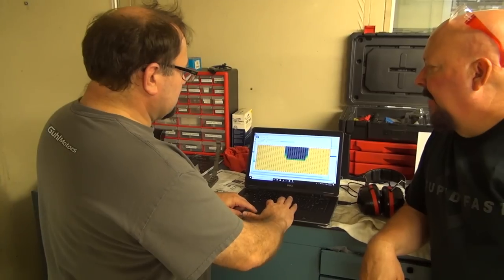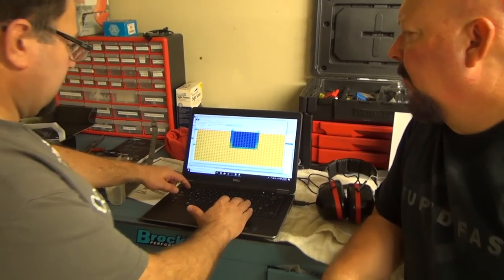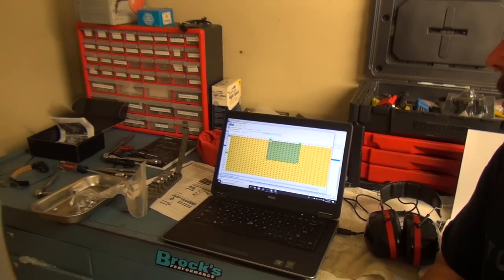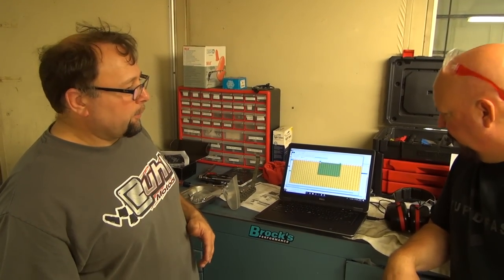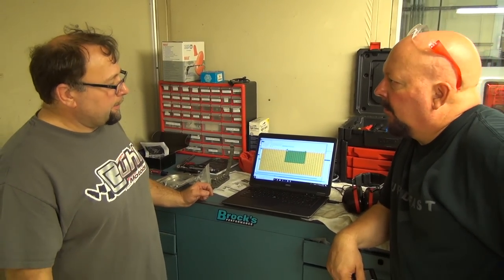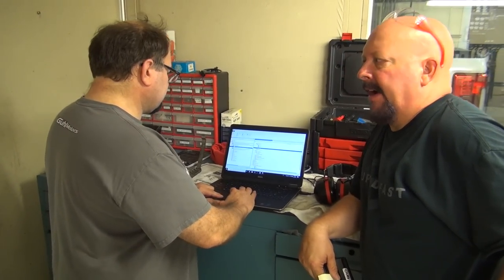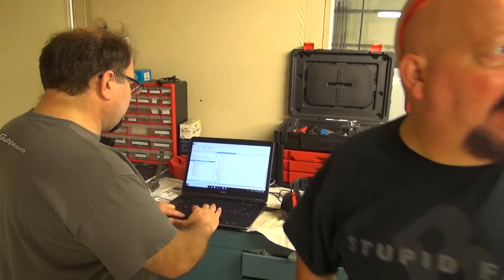So, since we're still running it, I'm just going to go ahead and de-restrict it fully as well. So it's basically the exhaust servo motor is going to be open the entire time. That way we can actually compare where they had it set factory, where we are wide open, and maybe there are some advantages that we'll see. Maybe not, but we'll find out. Okay. And then next we're going to go to fueling, try to get a little bit of that richness out up top. Go ahead and change the scale here.